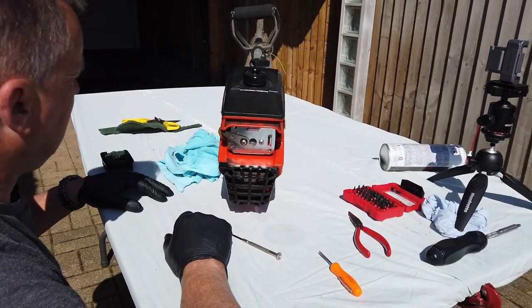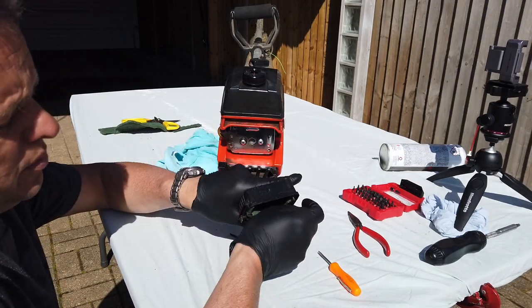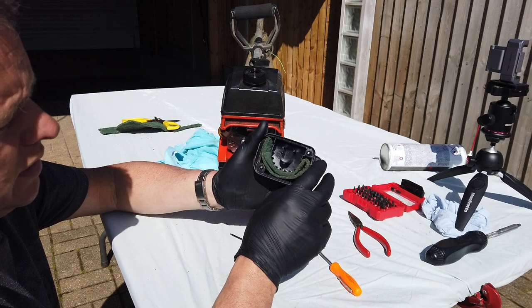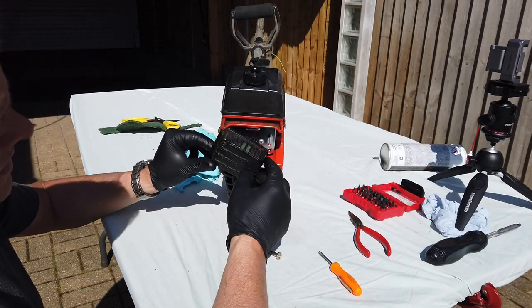We're back in there. Let's get his new makeshift air filter back on again. Like I say, I'll order a new foam, but in the meantime, Scotch Brite is a brilliant substitute because it is very porous and lets a lot of air through, and it's not oil. It won't deteriorate with oil. So let's get that back on again.